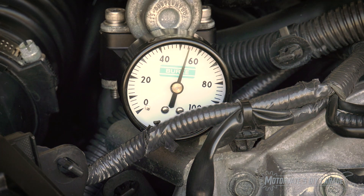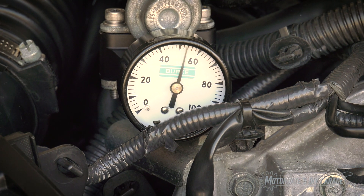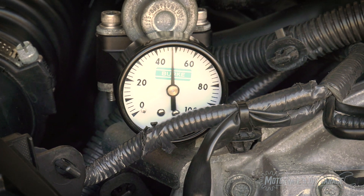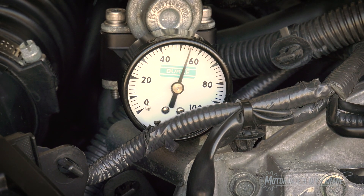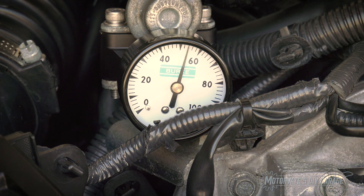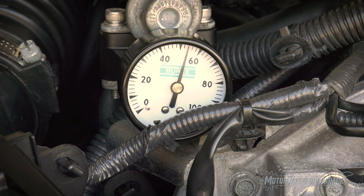As the air works through the fuel system, the pulses go away. It looks like we've got about 54 psi. Let me just rev the engine a little bit. We can see a momentary drop of fuel pressure, which is completely to be expected. This gauge is showing about 54 psi — but again, it's a $9 gauge. The good news is the factory spec is 51 psi or more, and we're showing about 54. So when you factor in any error from the gauge, we are good.